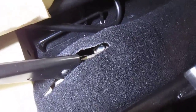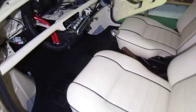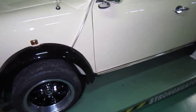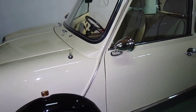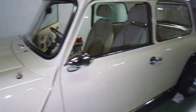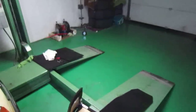So once all this is in tomorrow — get the seats in properly, put these in, and then the dash. So hopefully by tomorrow or the next day we'll have it in and ready. She went beautiful — she drives really well. Got to do the steering, obviously the steering is way out, but even so it runs beautifully and it's got a serious amount of power in it. God knows what it'll be like when that new Aldon Ignitor distributor comes — mind you, 170 quid, it should be good. It's for performance engines, cam changes and so on, so it's got a better advance curve on it. But 170 pounds is a lot of money — but I've gone this far.